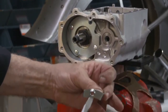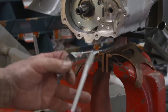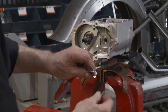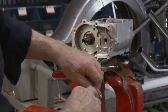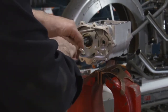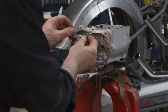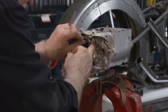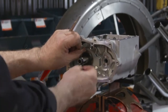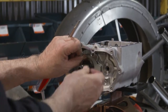This is countersunk into the retaining plate. It has a little hand or jaw to locate on the edge of the retaining plate. And this is going to be the little piece here that will catch the oil being fanned around as the motorcycle runs and drip it down onto the starter clutch. So we locate that. You see that little hand will kind of clasp at the edge of that retaining plate. We're countersunk for the screw hole. Again, a blue Loctite would be applied to this screw.